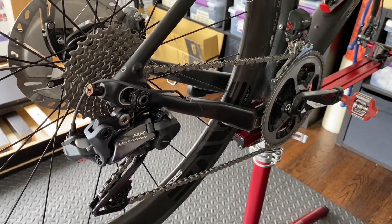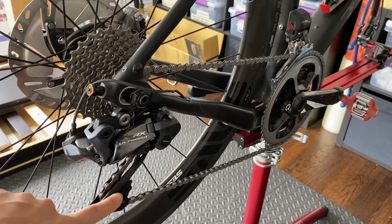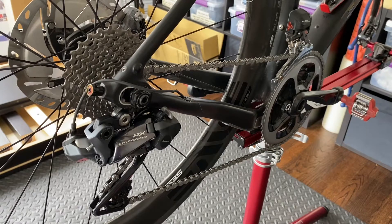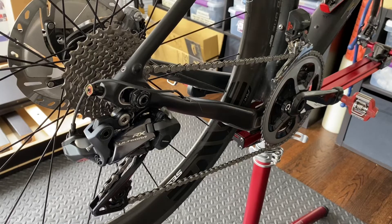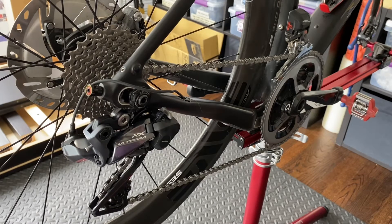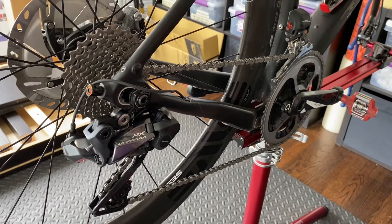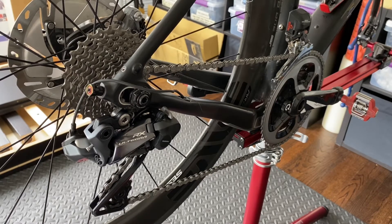My idea is to swap out this RX, which has a mid-length GS cage. Shimano derailleurs come with three different cage sizes: road usually comes with a short cage or SS, then there's a mid cage which is GS — that's this one — and then there's a long cage which comes on mountain bike derailleurs, the SGS cages. Those cages are usually rated for 11-42 or 11-46 and are found on derailleurs like the XT and XTR. So what I want to do is swap out this GS cage for an SGS cage, which hopefully will allow me to expand the maximum sprocket capacity to 46-tooth or even 50-tooth with a Wolf Tooth Road Link and some B-screw adjustments.